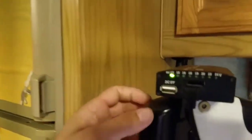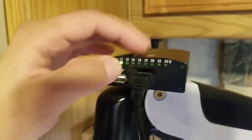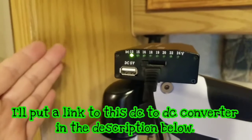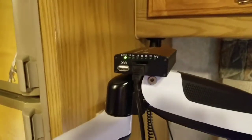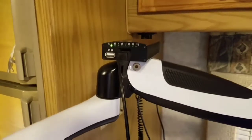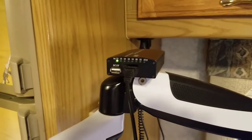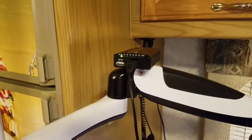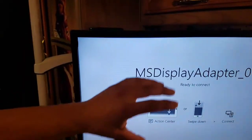Mine adjusts everywhere between 12 and 24 volts with a little switch. My TV is actually a 12-volt TV, and I use this converter to clean up my power system. I get static when my heater turns on or when different appliances turn on, and for some reason it creates static in the line on the TV — it shows funny lines on the screen and the audio messes up too.